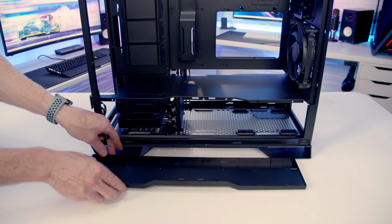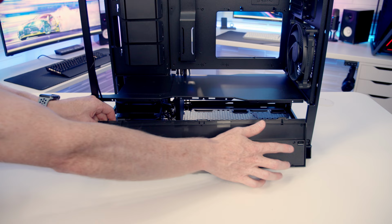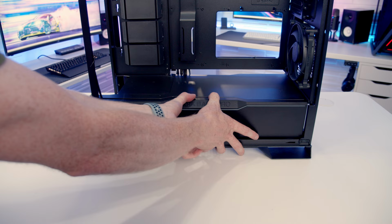We take a look at our side panel. We'll go ahead and get it plugged into here. And you'll notice we've got one connector on this side and one connector on this side, so that's how it's going to reach. Tuck the cable in out of the way, set the panel into place, and then we'll push down here to secure the panel into place.